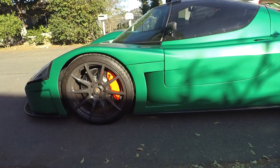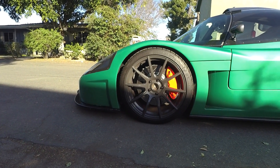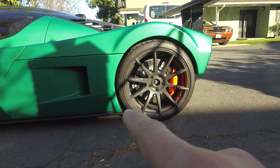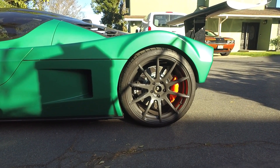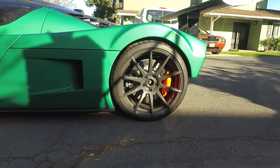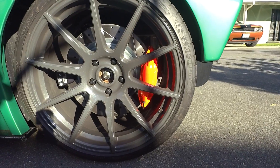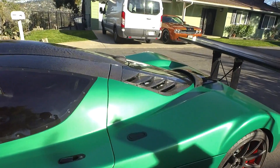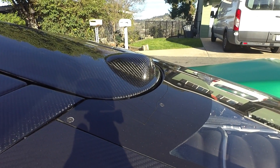It's very subtle, but what I also did was I re-contoured the front of the wheel well, and in the back over here, at the back of the rear wheel well there. The reason why I did that was because when the suspension was at full droop, if I wanted to pull the front or rear tires off, I had kind of a tough time because it was close to fouling. You can also see I powder coated the brakes, and then the last external thing is the roof mounted housing for my rear view mirror.